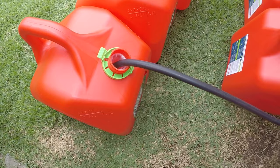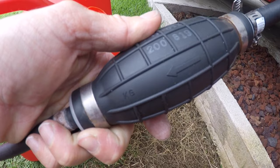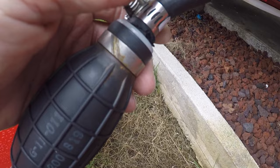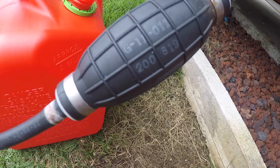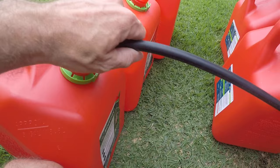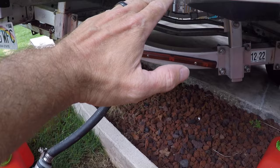These are five-gallon containers, so it'll probably take about five to ten minutes per container at that rate, but it's flowing and I don't have to do anything. What I've got here is just a regular primer bulb — one of these primer bulbs you'd use on any old outboard engine. The barb was a little loose so I put a hose clamp on it so it wouldn't have any air leak. Just make sure your arrow is facing the direction you want the gas to go. My gasoline output is low to the ground, and I have one steady constant climb up to my internal tank.